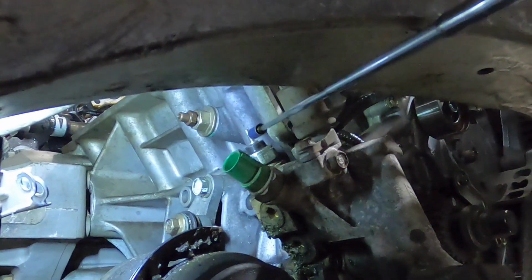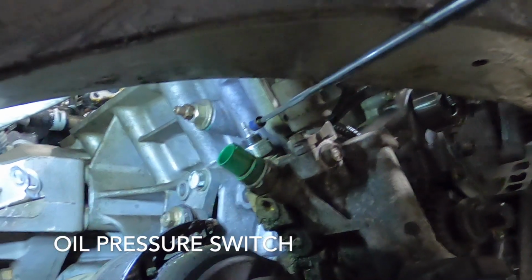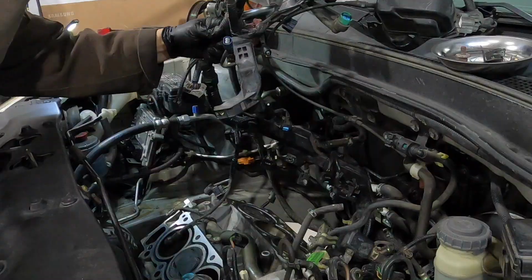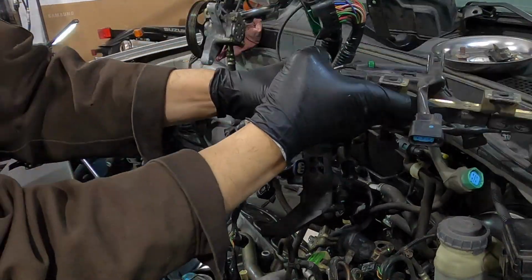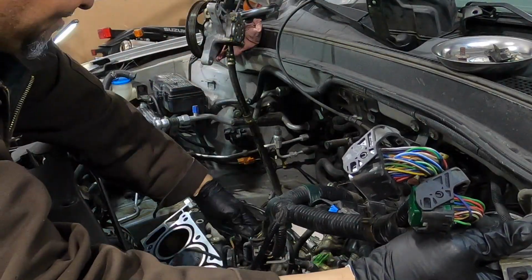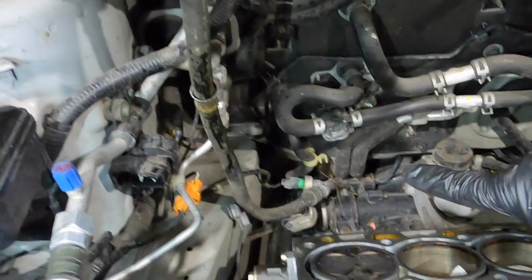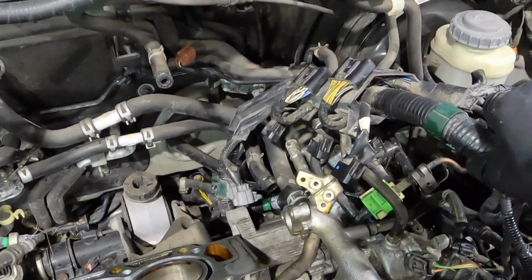That's the last piece of the puzzle. I was able to unplug that and get the harness completely pushed out of the way, and this is what the connector looked like. It unplugs like a spark plug boot. Now I got plenty of room to get the new head in and torque it down. I used baling wire to secure it out of the way.